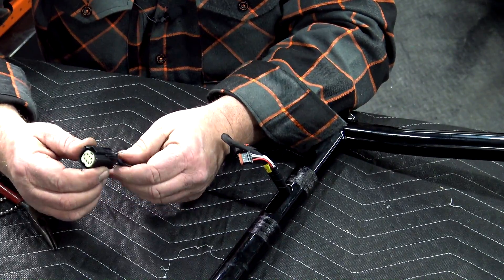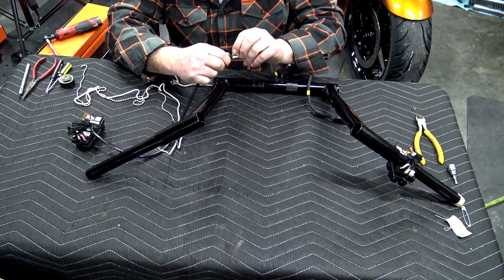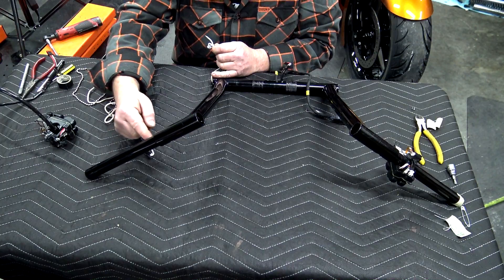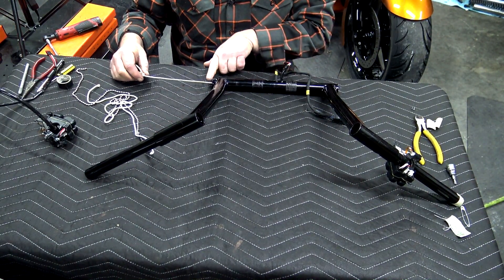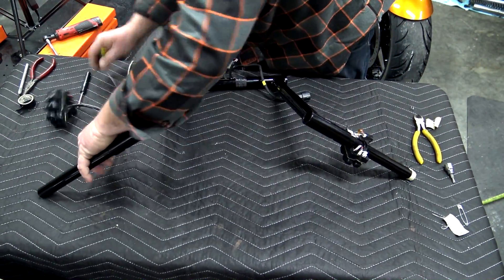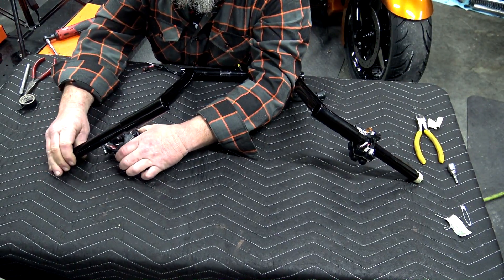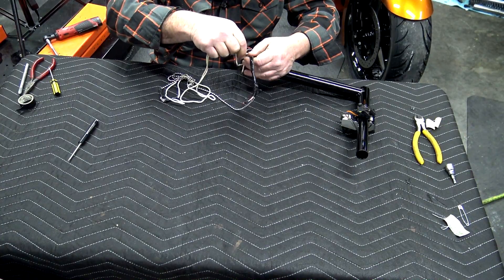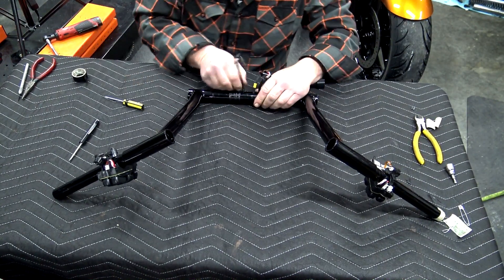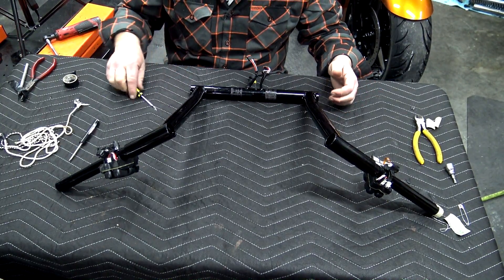The hard side is done. The other side is just a single wire on the left grip. Get that sticker out of the way, then feed that wire through and down the tube so it comes out the bottom — makes it a little easier. Drop the nut down the middle again, fish it out with a hook, pull it all the way through, then take your tape and string off. Now we have everything ready to put back on the bike.